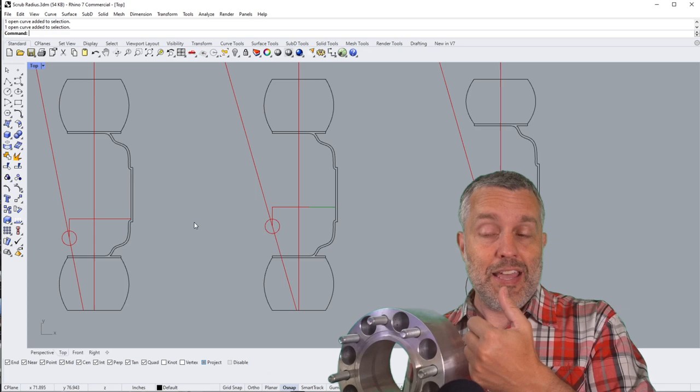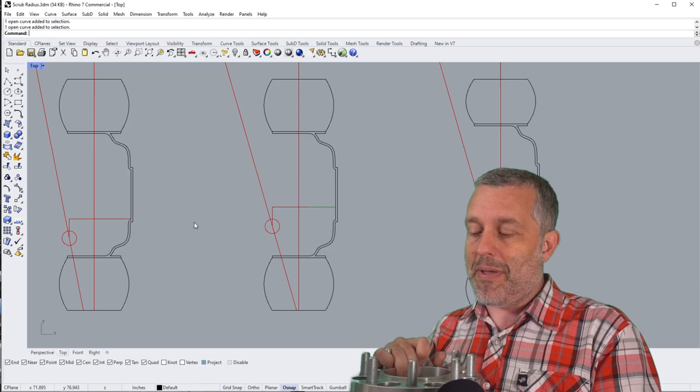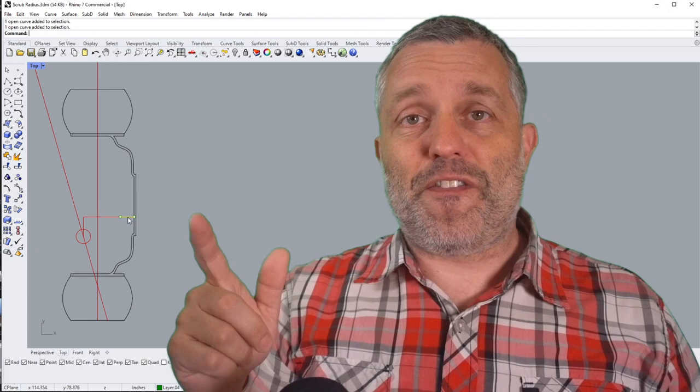The overall height hasn't changed — very important because in the rear, the two wheels need to clear all the center hardware for the crazy airbag suspension. If you go bigger than 30 inches or 29.5 inches (which is the stock size) you'll have problems. We really want to keep front and rear wheels matching so we carry only one spare and it also looks right. You can see here I've crossed the steering axis over the centerline of the wheel, giving us a negative scrub radius — actually more desirable. With a 1.75-inch spacer, we're back to the geometry the motorhome was designed for.